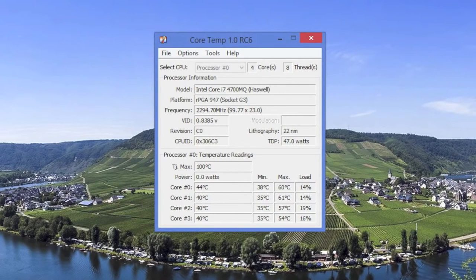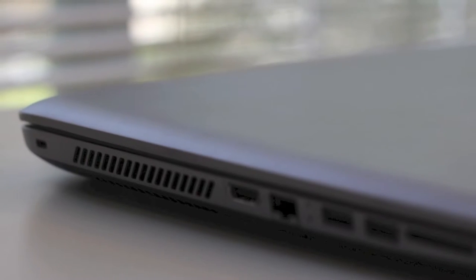Next up, let's test out the temperature performance from this laptop. With regular usage like browsing the web and watching 1080p YouTube clips, I was averaging anywhere from 40 to 44 degrees Celsius. Next up, let's go ahead and perform a heat stress test by running Cinebench CPU test 10 times